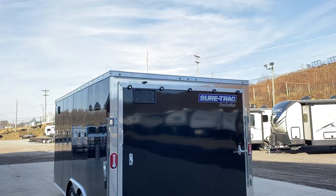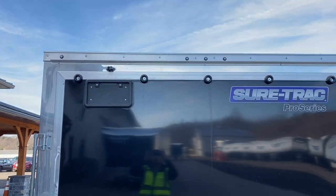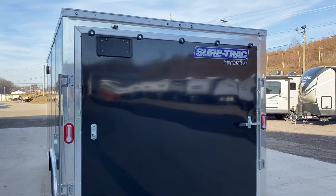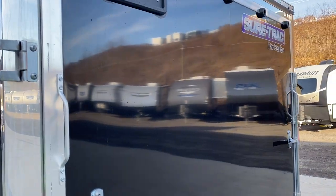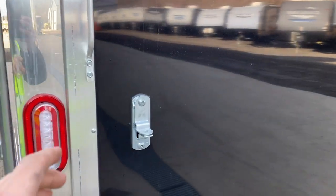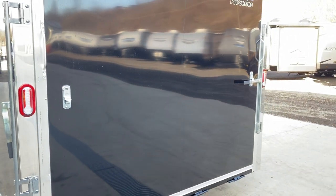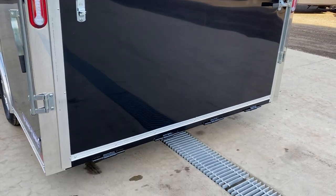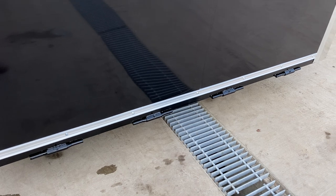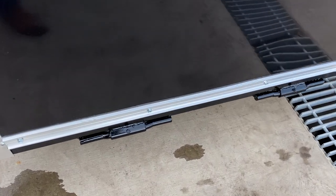As we go to the back of the door, you'll notice a few differences. This has five bumpers on the rear — a lot of times you'll see three or maybe four — just to help protect that rear door. Again, bullet LEDs with aluminum trim to finish it out; a lot of times I see steel that gets rusty over time. It also has two aluminum grab handles — a lot of times they only give you one, and it's plastic, but this one has two and they're aluminum, so more durable. The door hardware for your bar lock is actually Indiana-made hardware, not Chinese. It's a little bit taller hardware that functions a little bit better. This also has four full-width hinges — some use a five inch hinge, but this is about twice the width, and it has an extra one — designed for a higher duty cycle user. It also has a greaser for serviceability.